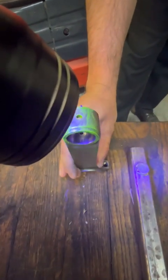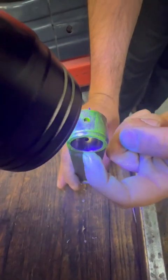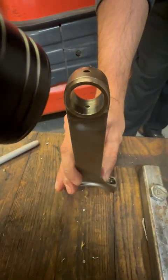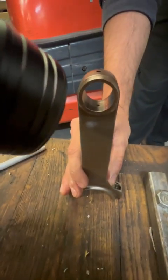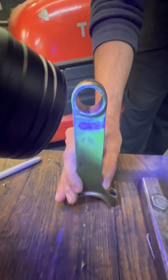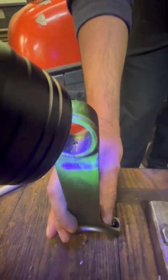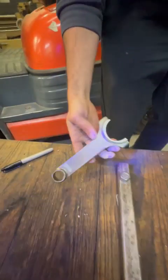And it goes up into this oiling hole inside the pin area too, on the inside of the pin bore. Right there. And then without the light, pretty much can't see anything. You can see a little bit inside the pin bore, but you can't see the severity of it — that it goes all the way around. You would think it was maybe just a line in the pin bore.